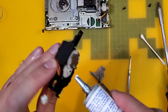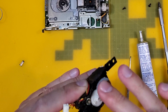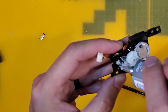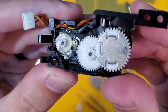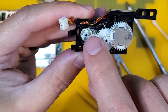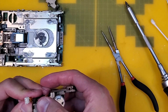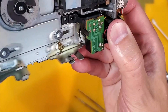When everything's clean we can re-grease the gears. Through the magic of 3D printing, here is a new gear. I'll grease up where it goes and drop it in place. It's very important to line up the rightmost gear at the three o'clock position — that's 1500 hours — which will allow the eject mechanism to connect with the top mechanism and move it back and forth. You can see where it attaches into the hole and slides the plate out, thus ejecting the disk.